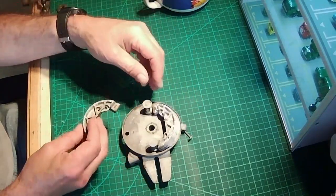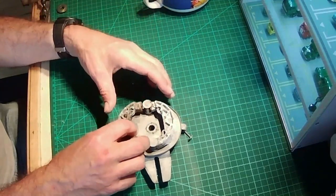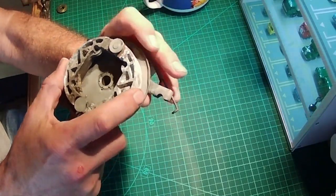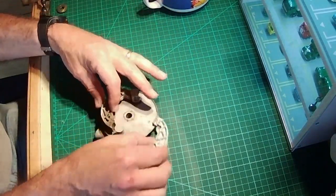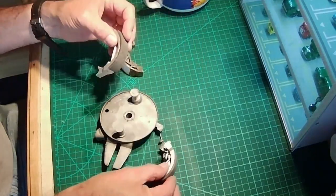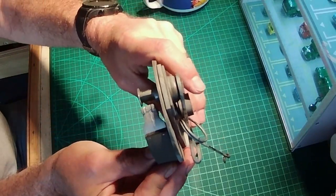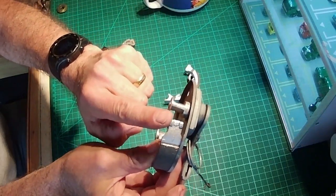Now this is where I came to a little bit of a problem. This is the old brake shoes, which clip in at one end and go onto this cam, and then there's the lever — when you pull the brake cable that opens up the brake shoes onto the drum. But the problem I had is the new ones: getting ready to measure them up for size is okay, but when you get to the cam bit, it's just a little bit too wide to fit in there, so that needed a little bit of fixing.